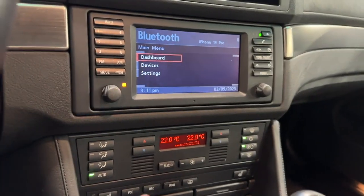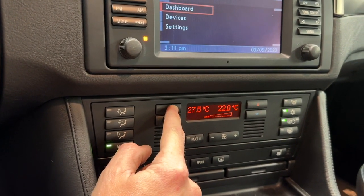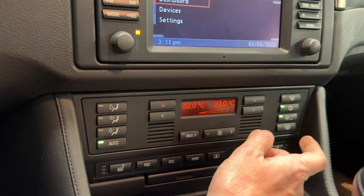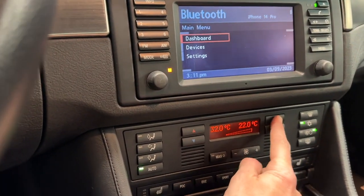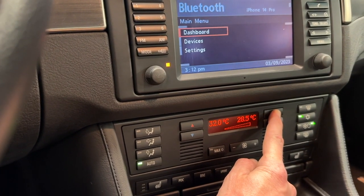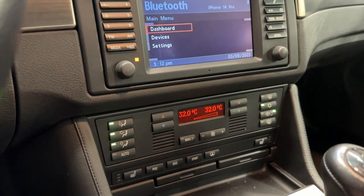With the car idling, we're going to make a few adjustments to the heater — bring that all the way up on both temperatures. Turn recirculation on and move the heat dial all the way to warm, fan speed low. That's going to cycle coolant through the heater core and let us bleed the system out a little better. You can also turn on all three zones.